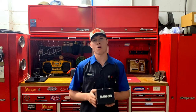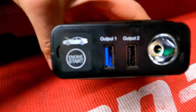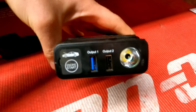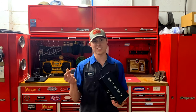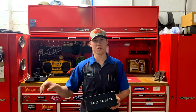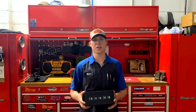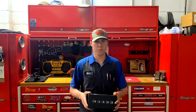This thing actually has smart protection. It does reverse polarity protection, so if you hook the jumper wires up backwards onto the battery of your car, you could fry your ECU, pop every fuse in the car — some bad stuff. This thing is supposed to protect against that. If you hook it up backwards, it senses that and breaks open inside so it does not put voltage backwards into your car. It is on most newer jump start boxes you're buying today — most come standard with that.